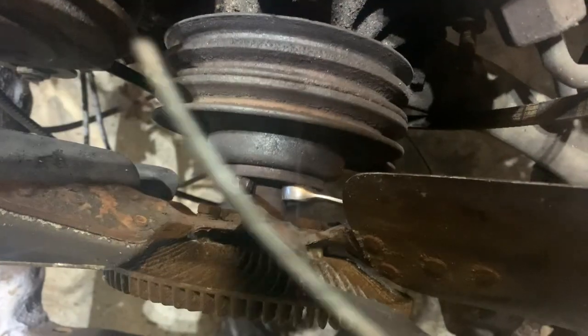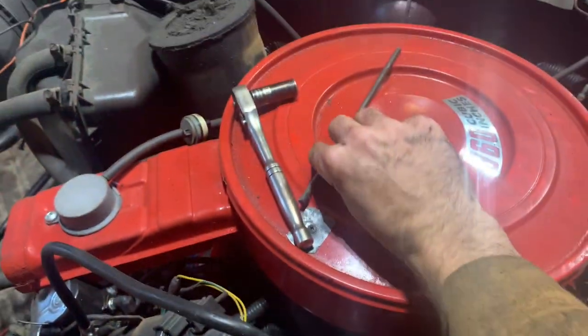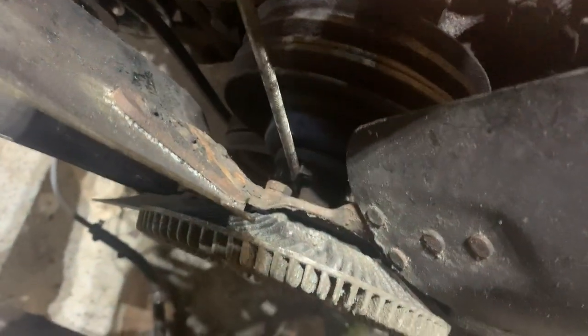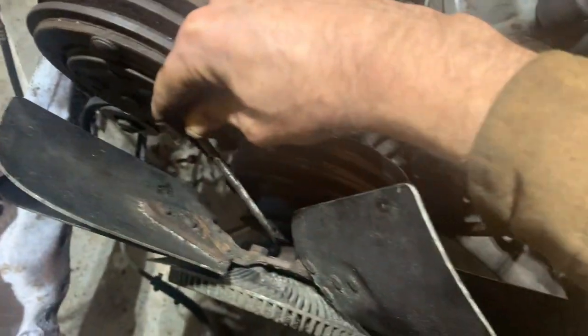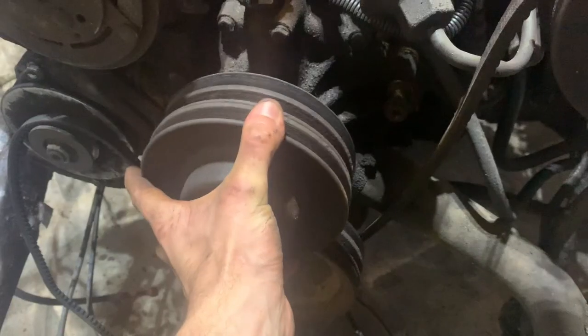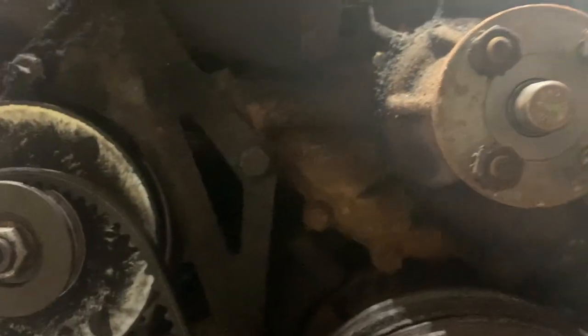With both those belts out of the way we can focus on this fan. There's just four bolts — it takes a 13 — and this whole front fan section should be able to come off. When you go to remove these bolts you can find it a little tricky. One solution: get a thin rod like this and weasel it in between two of those bolts — this will give you leverage for when you need to undo that last bolt. With those four bolts removed, this should just pop out, and that pulley should also be able to pop out, which it does.